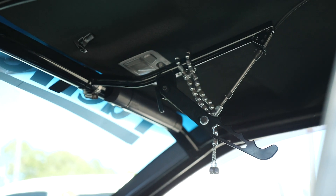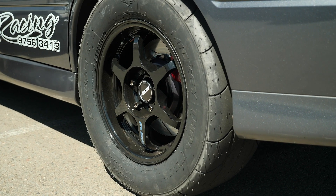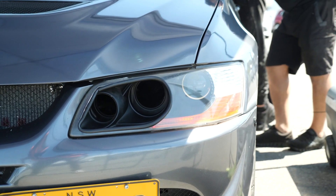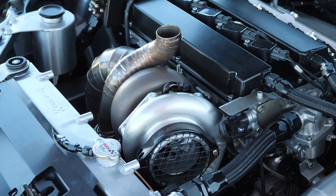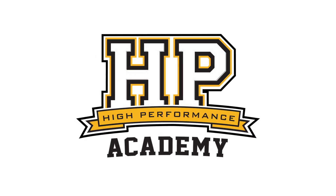With all four wheels doing the driving, there's a lot of traction, and particularly on a very sticky drag strip this can be a problem. We generally see a lot of four wheel drive drag cars either bog when the driver sidesteps the clutch and go nowhere, or alternatively light up in wheel spin. But definitely the worst scenario is breaking some of the drivetrain components.